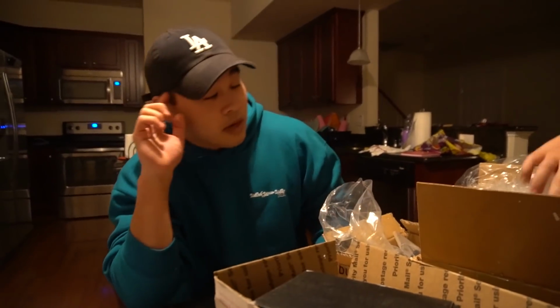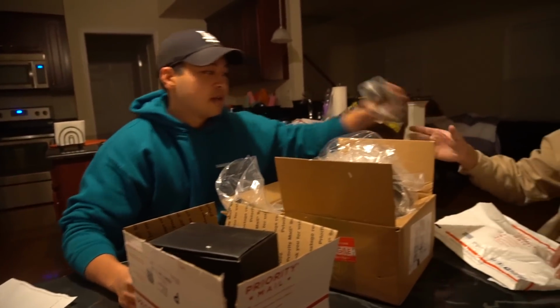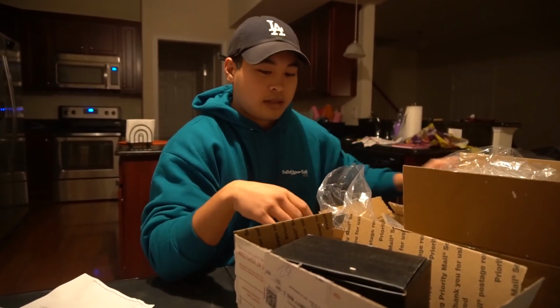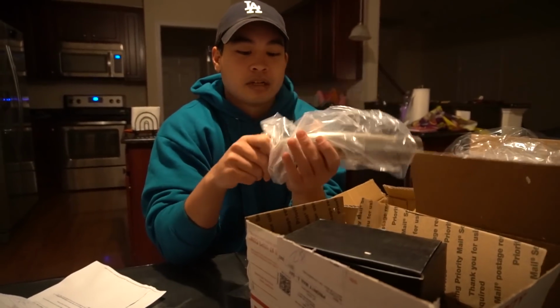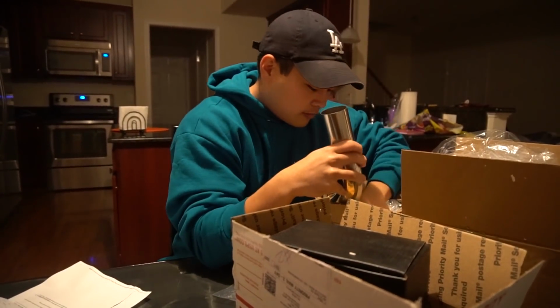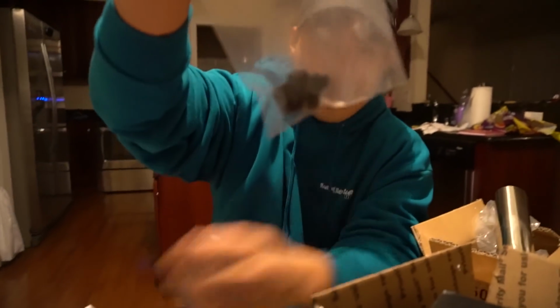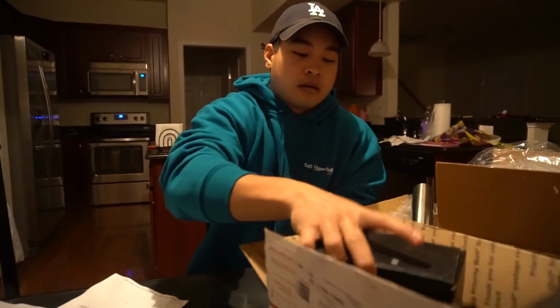What's up, guys? So we just went over Winsen's parts, and now we can go over my parts for my swap. And we got the same manifold, but I got the right adapter, as you guys saw on his segment. And then here is my dump tube, screamer pipe, whatever you guys call it. But yeah, nice one. It's 50 mil. Cool. And then gaskets and stuff for that. I got the oil feed line adapter that goes onto the block where your oil feed will go. All that jazz.